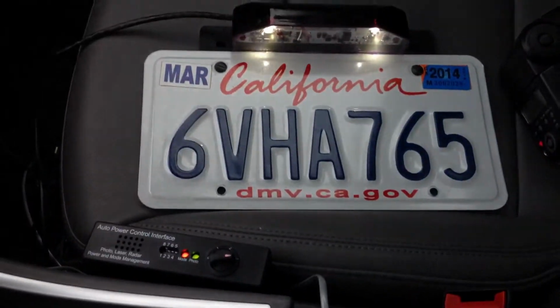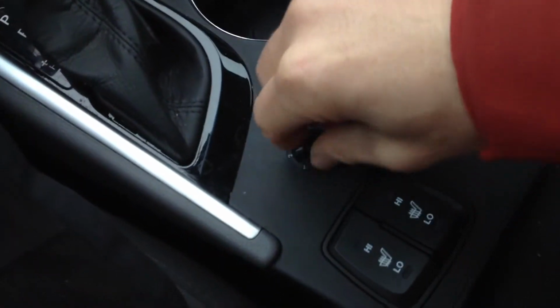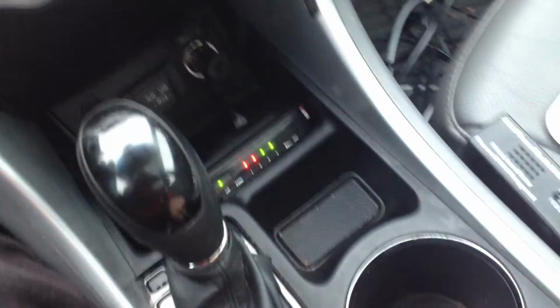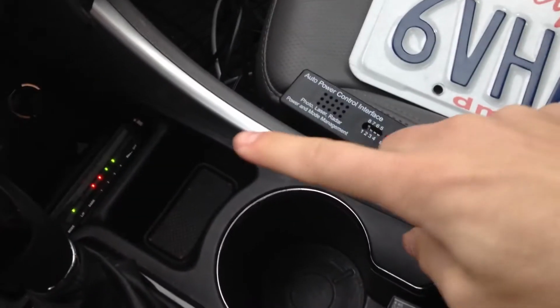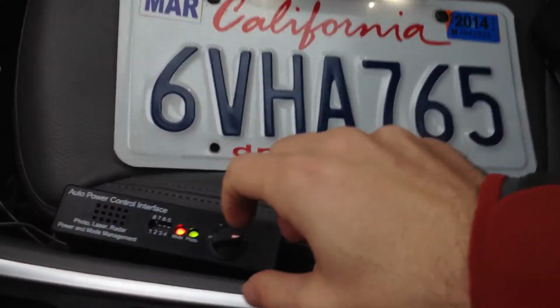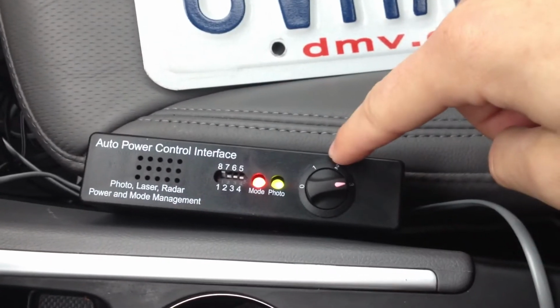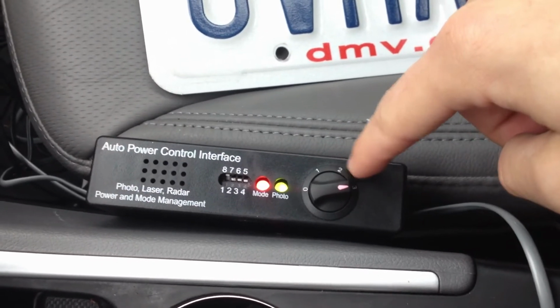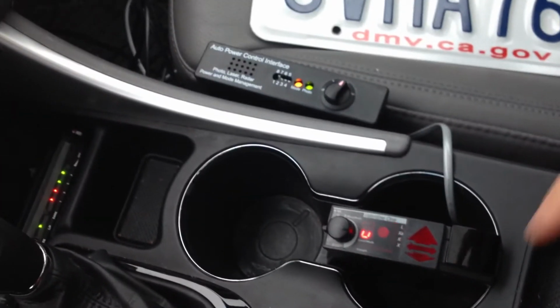So let's go ahead and now start walking through the other modes. I've got my HP 905 switch here that I normally use. Right now it's disconnected. You'll see it's not going to do anything to my jammers. However, when I start messing with this one, it will affect my jammers. So it's hooked up there. So if you get shot with laser and you want a JTK, the way you do it with the HP 905s is you set from 3 to 2. Change it from jam to receive mode. So do that. And it cuts power.